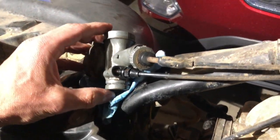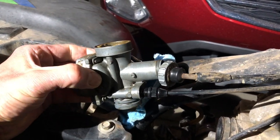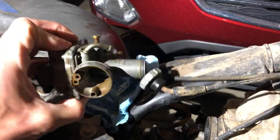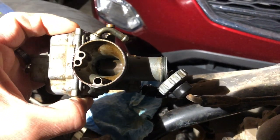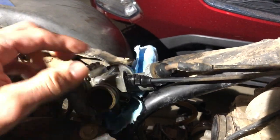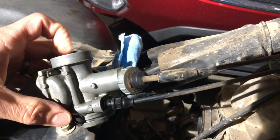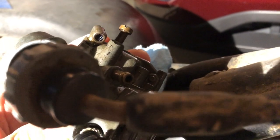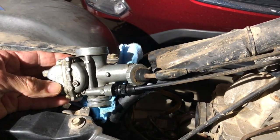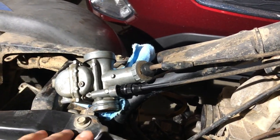We're back in my garage and this thing's been sitting for quite a few days with WD-40 in it and some carb cleaner, spraying it every couple days. But the slide in there is still seized solid, as well as the choke cable — it's unscrewed but rusted in something down inside. That feed line from the tank to the port here is plugged solid, so the tank had a bunch of rust in it and I think this is going to be all gummed up as well.